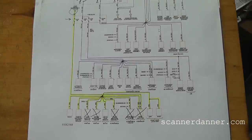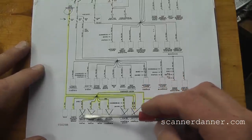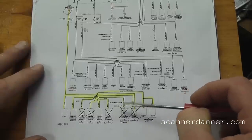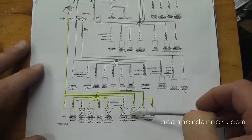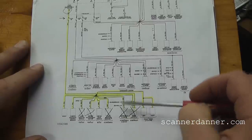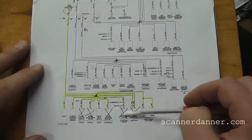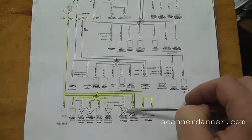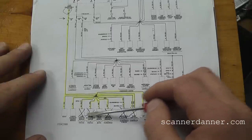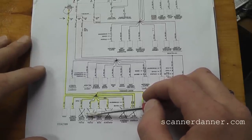The radio was still on our mind because that's what he said — this problem didn't start until he removed it. So we looked for our next easiest thing. We had crossed all the Chevy and Oldsmobile entries off the diagram. We unplugged the instrument cluster to make sure that wasn't our draw — that's why I X'd that one out. These Pontiac entries we don't have, though as bad as our diagrams are, we may have to revisit those.